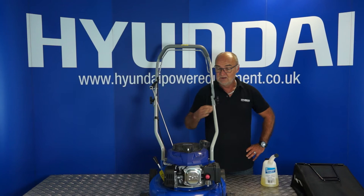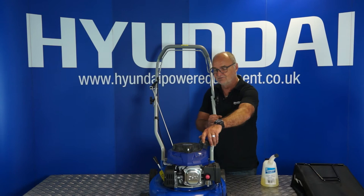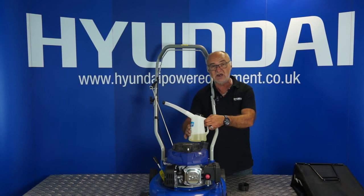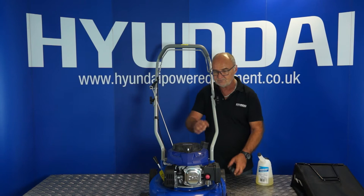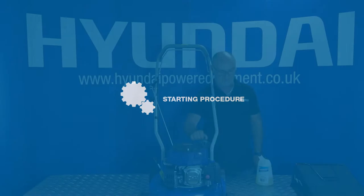Let's move on to fueling your lawnmower. First, a little safety note: never fill the engine when the engine is hot. The exhaust will be hot and should you spill any fuel it would be a fire risk, so allow it time to cool down before refueling. To fuel the lawnmower, remove the fuel filler cap by turning it anti-clockwise. Use fresh unleaded petrol — not two-stroke or anything like that, fresh unleaded petrol, no additives. Fill the fuel tank to within about 25 millimetres of the top of the tank, or an inch down from the top of the filler neck, to allow room for expansion of the fuel. Having filled up with fresh unleaded fuel, back on with the fuel filler cap, and that's the fuel filled.